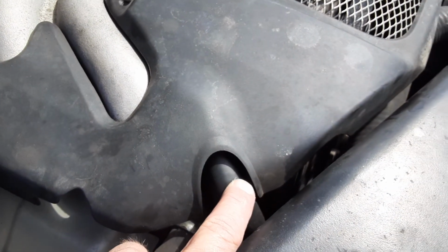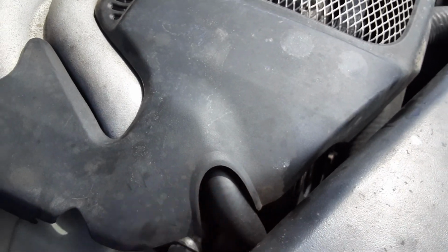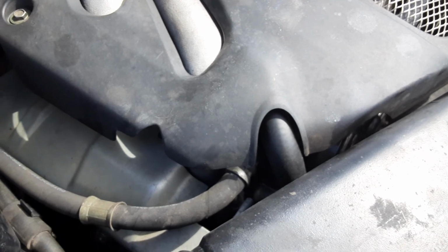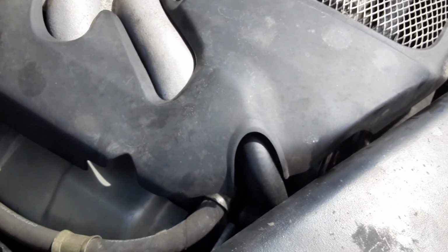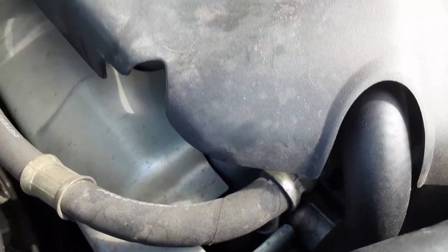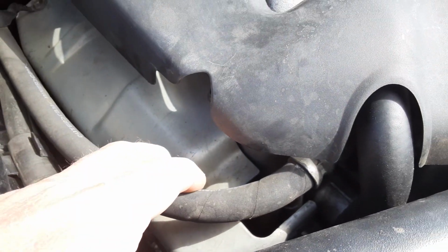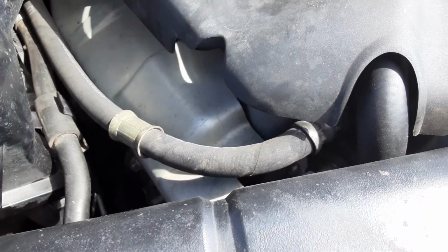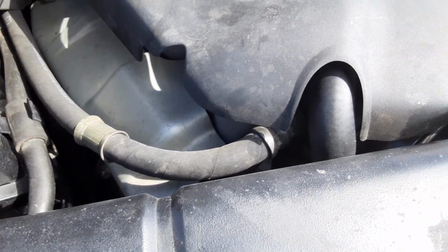The only reason why they don't work is once this hose gets hard and you move it around, then you're going to create air suction, because the power steering pump sucks only from that hose. The other one, which is this line, is the high pressure. And like I said, anything leaking out is just going to be a leak. It's not going to create air bubbles.